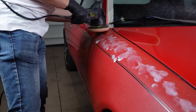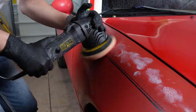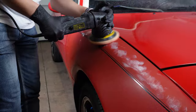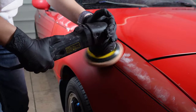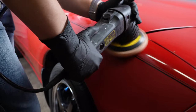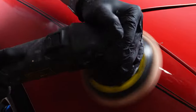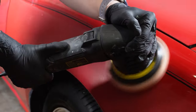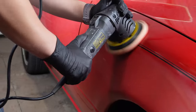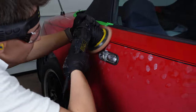Now, what is single stage paint? Basically, single stage paint is just one thing being sprayed on your car. The current solution to painting is actually dual stage or tri-stage paint, where you would have a primer, a base, and then a clear coat. Whereas with a single stage, you would spray this direct onto the car. This was much more efficient because you only needed one type of paint, but was more expensive as the cost per liter of this paint, heavy with pigments, was way more expensive.